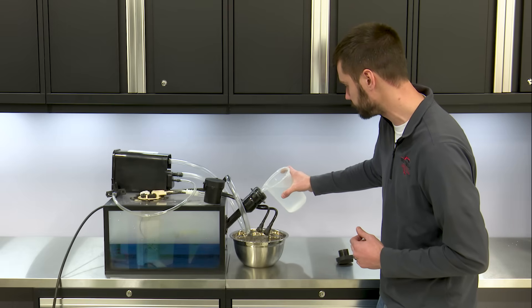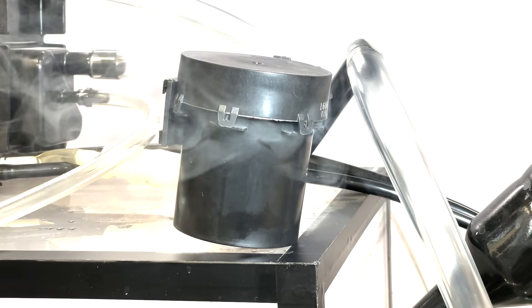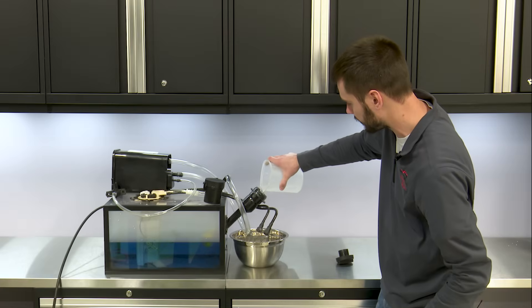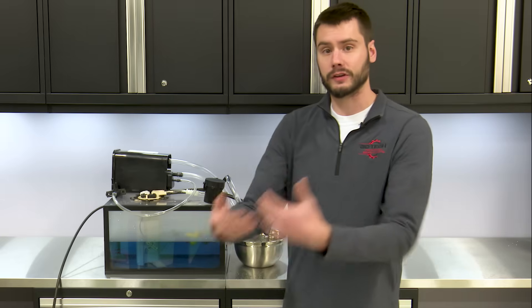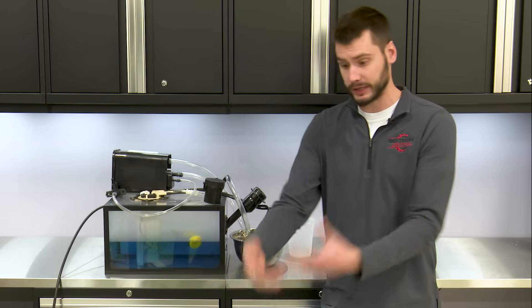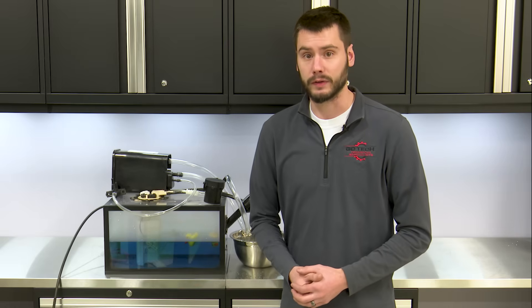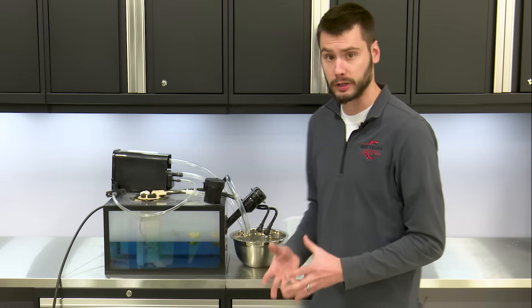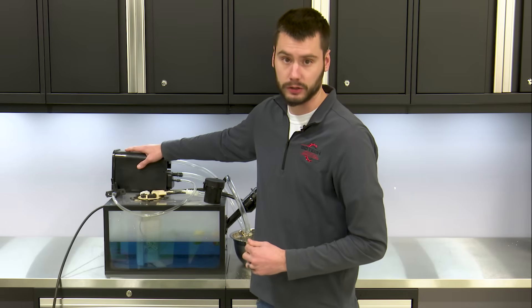We're going to fill this thing up with fuel. We got a lot of smoke coming out of the filler neck, but there we go — it's coming out of the vent solenoid. Where I accidentally spilled water out, that's because the pressure of the fuel tank was actually pushing back on me dumping water in there. We don't want that when filling up with gas or we'd have gas spraying back at us. What shuts the nozzle off is that pressure buildup in the tank — it's essentially a safety feature that tells us when the tank is full. We need to get that pressure out through the vent solenoid after it's been filtered by the charcoal canister.